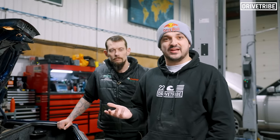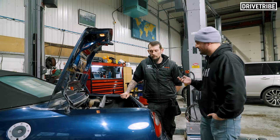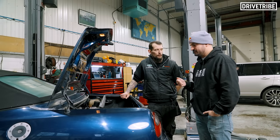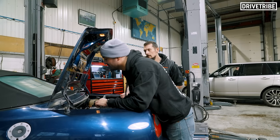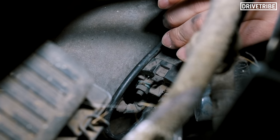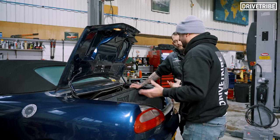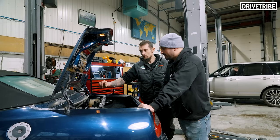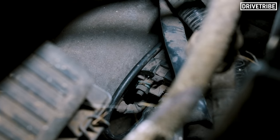About 10 minutes after Alex left us with the car it stopped starting, but it turns out it was just an electrical connection. The connections on the starter motor - the wires that go to it - have just got a little bit of corrosion on them. The starter motor is right down in there; not the easiest one to get to, but it's doable. We don't need any parts, it just needs cleaning up. Pull the wires off the back, undo the main power wire, get some Scotch-Brite on them. There's a small handheld sand blaster to clean up the inside, then we'll stick something on it to stop it corroding again.